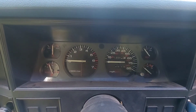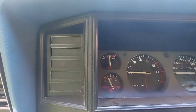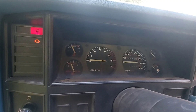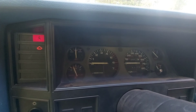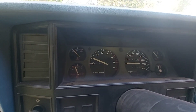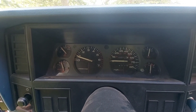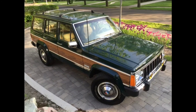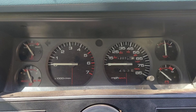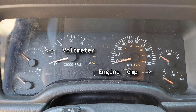On 1984-96 models the cluster is much more basic, featuring a physical odometer and a small separate panel for the error lights. These older gauges aren't exactly instruments of precision, so especially on RENIX and prior years don't go crazy if something isn't in its exact range. The warning lights all pretty much mean the same things described earlier, but the check engine light on RENIX models doesn't actually store error codes, and high output XJs use an OBD1 system so you'll need a different scanner. Interestingly, the voltmeter and engine temperature gauges were swapped on the redesign — if anyone knows why, please enlighten me.